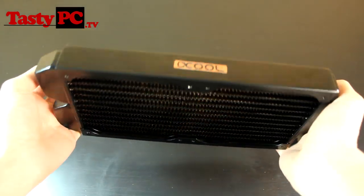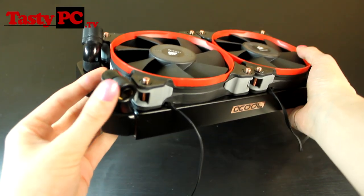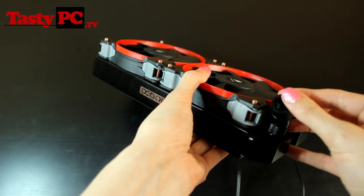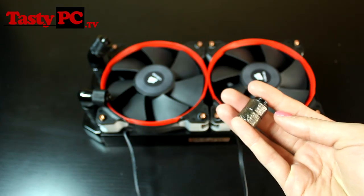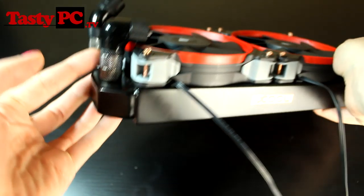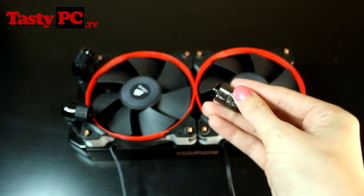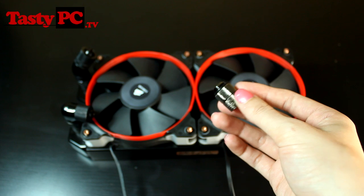This is the Alpha Cool 240mm radiator that I'm going to be using. I have already fitted the fans and the fittings, although I have run into a problem: the fittings aren't long enough to clear the fans, so I can't point them in the direction that's needed. I'm going to get some 25mm extensions ordered. In the end, I decided to go with 25mm G quarter inch extensions from Phobia — they're the exact length needed to clear the fan, they're rotatable, and they're a lot cheaper than most other extensions available. Unfortunately I could only get them in black nickel, so it doesn't really go with the rest of the fittings, but it should still look pretty good altogether.